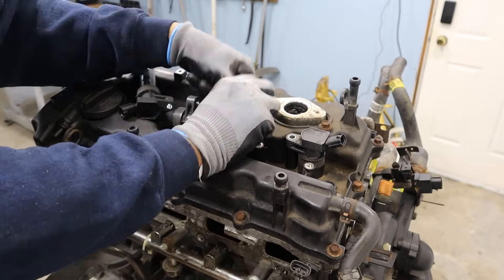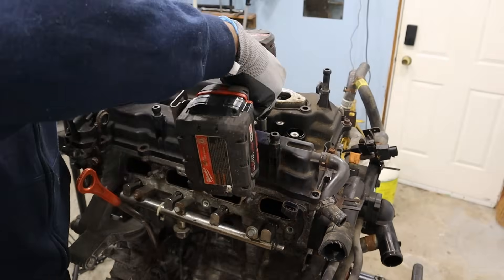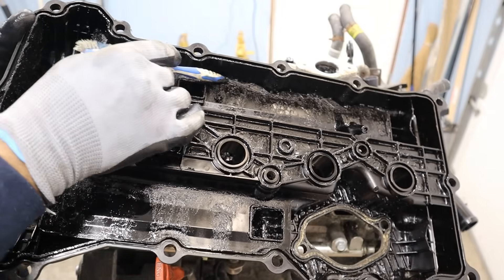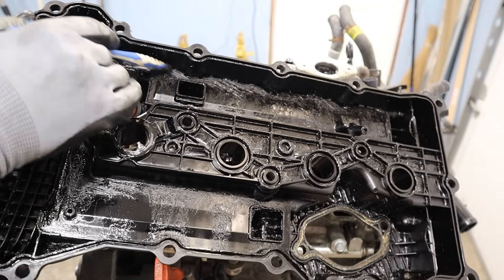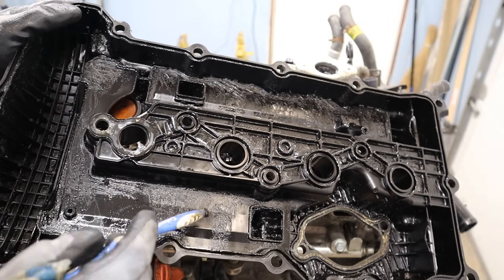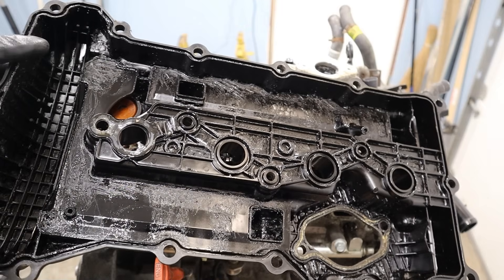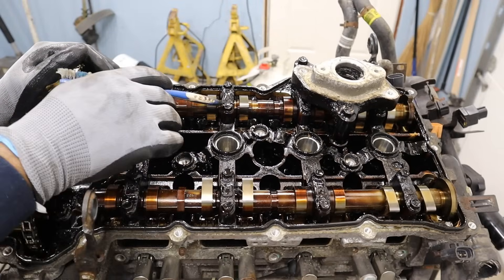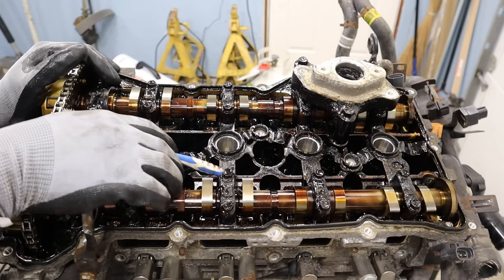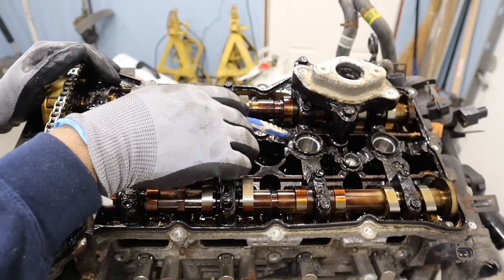Let's get the coils off. Next up we're going to remove the valve cover — 10mm bolts all the way around. Oh no — this one's sludged. Taking a look under the valve cover, you can see there's a lot of sludge built up underneath here, which is not good. That means it definitely followed the manufacturer's oil change interval of 7,000 to 12,000 miles, which is way too long for an engine like this — especially a gasoline direct injection engine. The sludge is going to tend to build up and clog things. Everything under the valve cover is absolutely black, tarnished, with sludge buildup everywhere. This stuff is just building up everywhere, waiting to clog an oil passage.